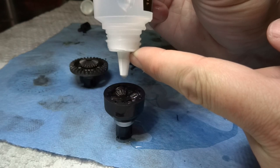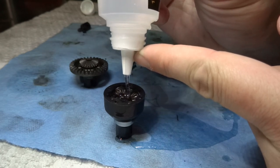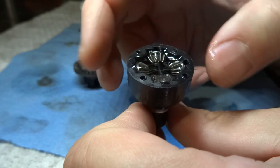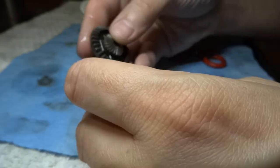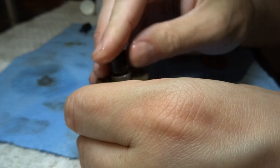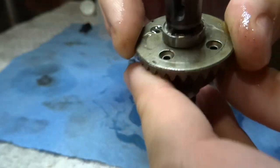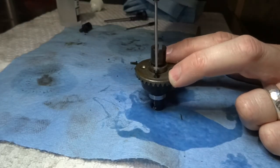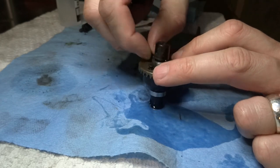Squeezing too hard — because you've got to squeeze that hard to get it to come out. I don't want to wait half an hour trying to fill up a diff cup. That's pretty good — I'd say that is full, almost too much. Just shove that down on top. Put this in until the key engages — there we go, engaged. I'm just going to put my screws in. Remember, it's a plastic diff cup, so just go easy. Make sure it's actually engaging threads.